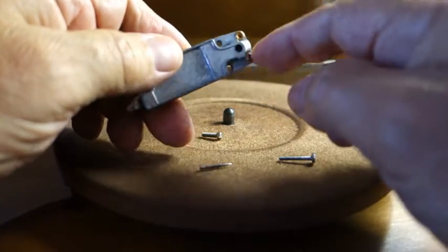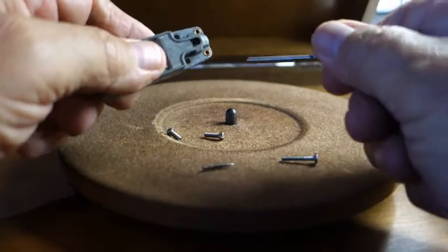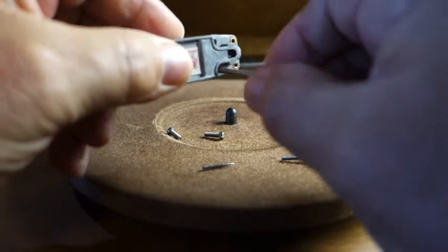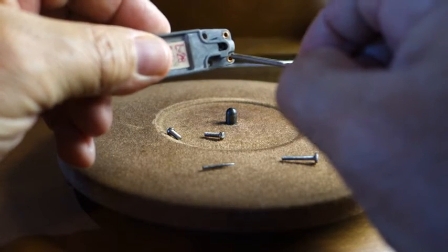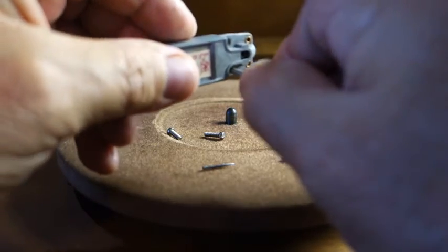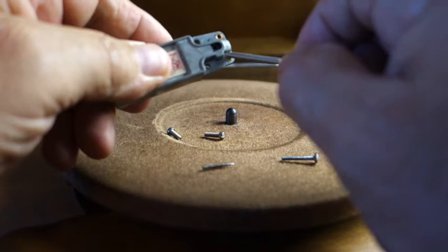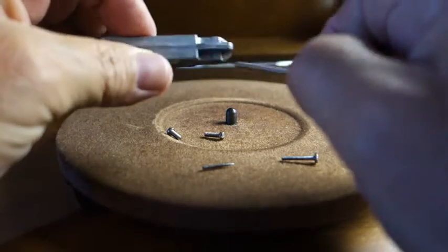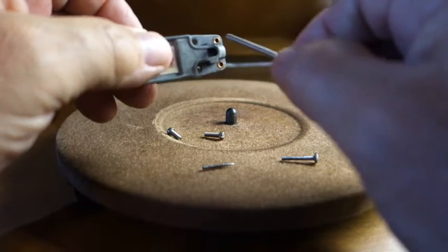These rivets have to come off, so we'll go downstairs and take them off. Find a drill that's about the size of these holes. I made the mistake of sharpening that drill and it grabbed and broke part of that housing. I'm doing the audio after the fact so I know exactly what's going to happen next. I have to go downstairs and drill those rivets out.